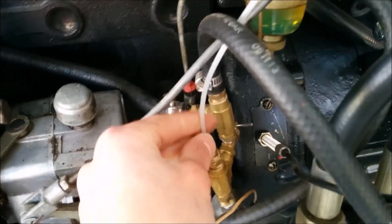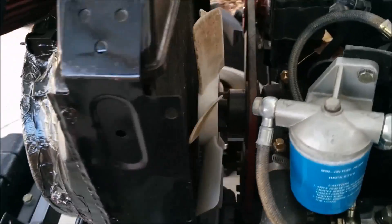And then the oil line right here goes up to the pressure gauge, and then this other oil line goes over to feed the top of the turbo. We also have another oil line coming right from here which goes to the engine oil pressure gauge, so there are two oil pressure gauges. And then the line right here is going to a boost gauge so we can watch pressure.